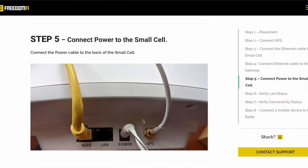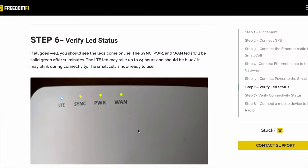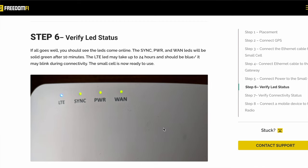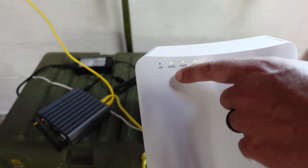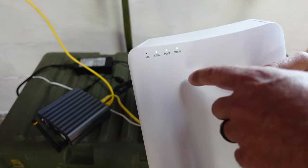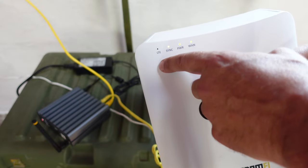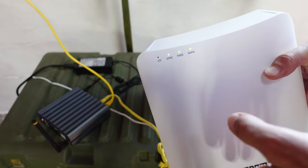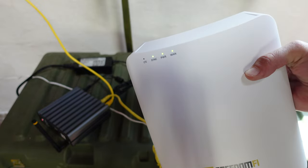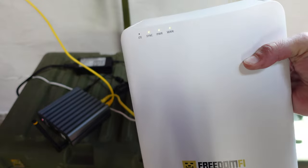Next, hook up the power to the CBRS radio. You have two choices: there's a power cord, or you can power it over Ethernet — your pick. Once it's powered up you'll see these lights; initially it'll take a few minutes, and this unit did reboot on me two or three times. Once fully powered up, these three lights will be green. There's a fourth light that needs to be blue — if it's not blue you'll have issues, most likely your GPS isn't getting a lock. You may need to move it around, get better coverage, or position it closer to a window with line of sight.